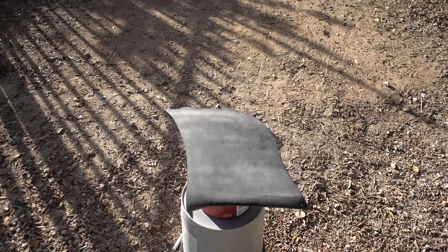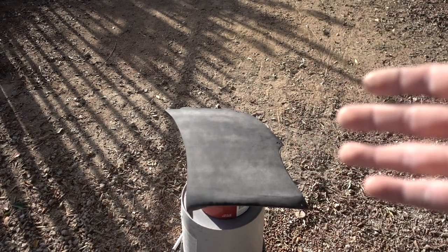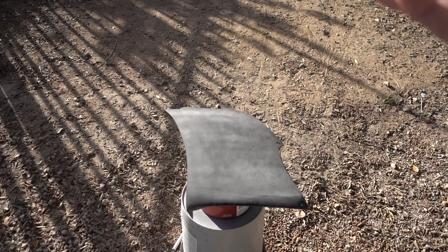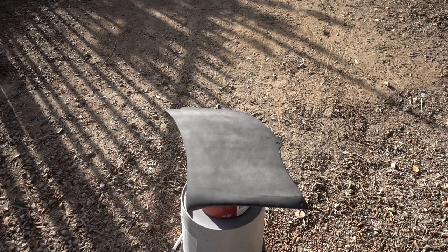So I'm just gonna wait for this to dry completely, and then we're gonna start sanding it. What it's supposed to do is, since it was a white primer base, when you sand it all off, it's all gonna be white again, but there's gonna be some black spots pointing out the pinholes and the scratches, which is gonna make it a lot easier to know what areas you have to fix, what areas you have to fill in, and stuff like that.